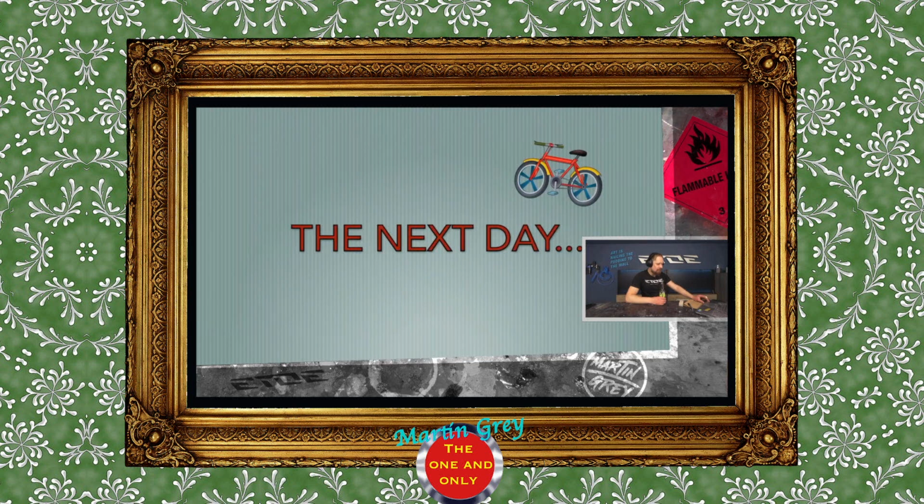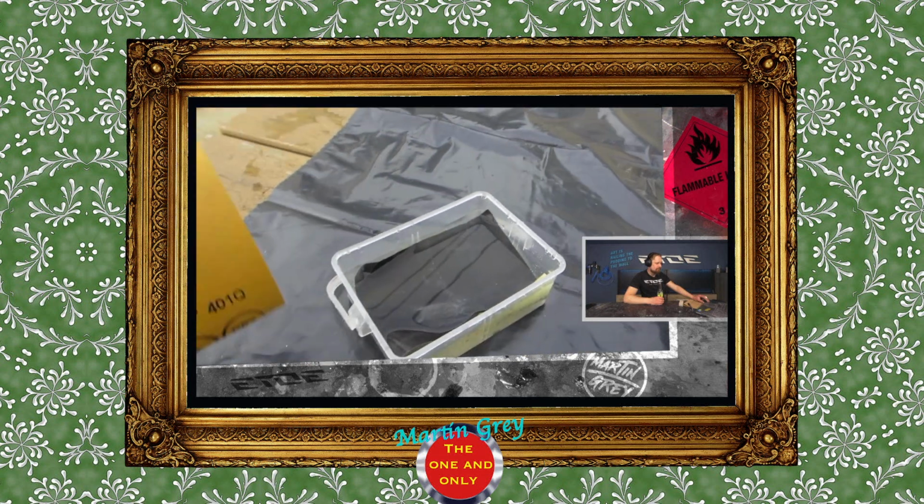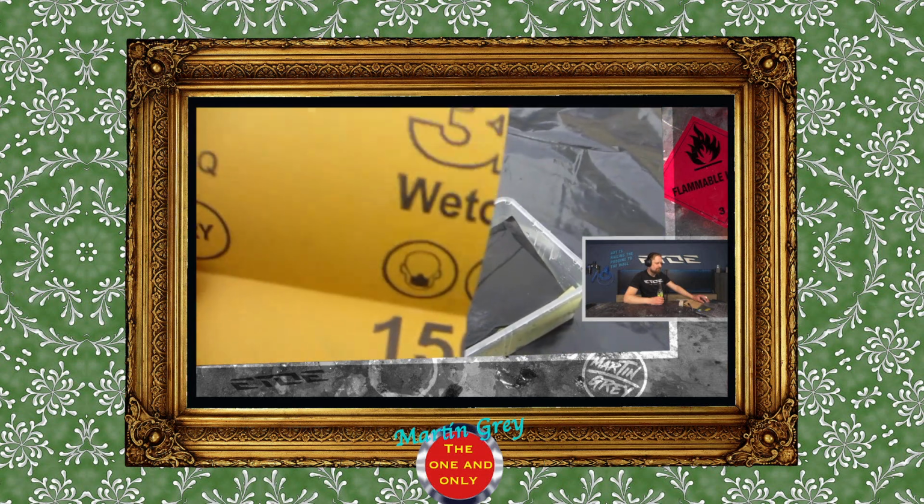I recommend also maybe 12 to 24 hours depending on your primer minimum curing time. Then you can go ahead with sanding. See, what I do is I use this sandpaper. This one is 1500 grit. This is almost a little bit too fine.